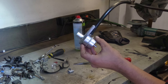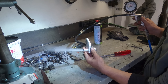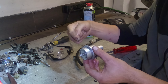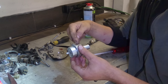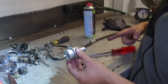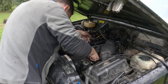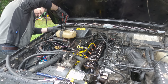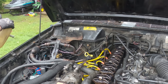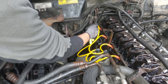But now it's time to take a look at the fuel pressure regulator and figure out why it's completely blocked — although I have a sneaking suspicion that it's actually totally fine. From the references I've seen online, it's marked that the fuel in is at the front of the rail and the fuel out back to the tank is at the back. I can put air through the other way — it's opening at 39 psi, exactly where it should. Maybe the rail runs where the fuel enters one side and comes back through the other, so it's regulating the pressure in the rail and only releasing it when it reaches 39 psi. I feel like I've clearly misunderstood something or interpreted information incorrectly. But regardless, the regulator is working absolutely fine, it's clean inside, and I don't need another one — so that's perfect.